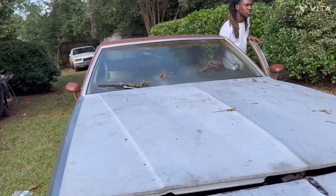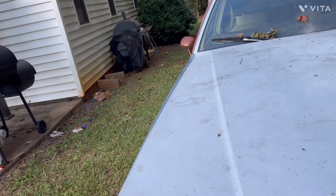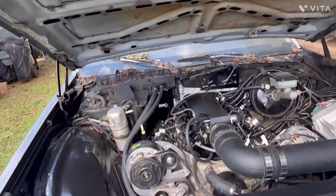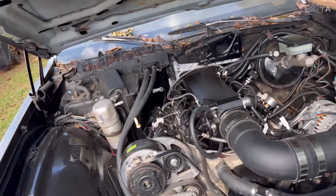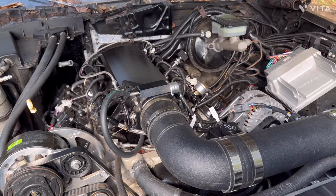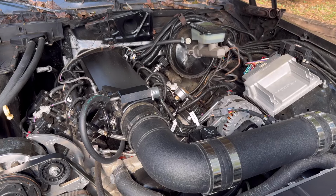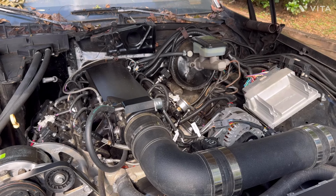Yeah, like I say, that IAC got to work properly for you to get all the response you're supposed to get. So that's the next step, gang. I'm going to drop it down to a 90, man, and get that other bracket, just in case I had to go all the way back down to a 78.